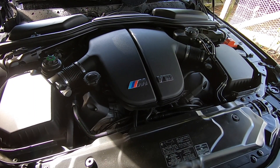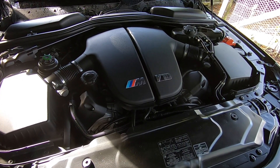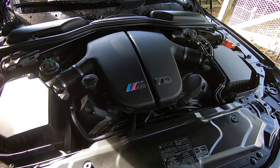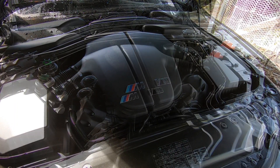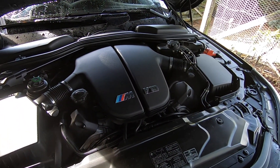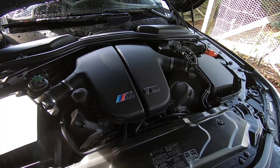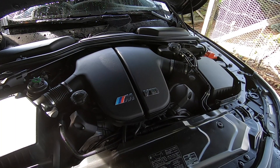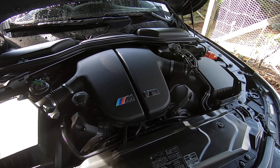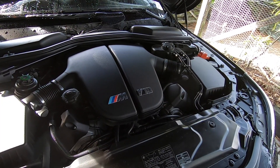When diagnosing the supply lines or the Vanos pump, you want to check the Vanos oil pressure. As mentioned earlier, the computer can't see the oil pressure directly — it's just looking at things relatively, based on how the Vanos solenoids are performing and whether targets have been reached. The correct way to check the pressure is to install a pressure gauge on top of the system, but keep in mind that this Vanos system runs at extremely high oil pressure — around 115 bar. Whatever gauge you're using, make sure it's rated for that pressure. Don't use any old gauge; if it blows off, it's extremely dangerous. Use the proper equipment.